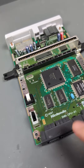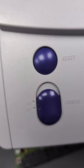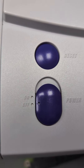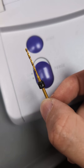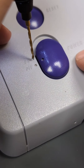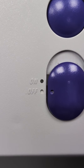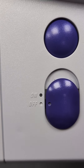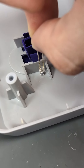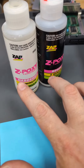Next up, for a power LED mod — on the original SNES it actually has a light, but you can see on the Junior there's no power light. What we'll do is put a power light where the on little dot is, just pilot hole that out, and then fill it with epoxy to give it a nice clear finish with an LED. We'll use a 1.4mm drill bit, which fits perfectly in the hole. That gives us a nice seamless hole to get the LED to shine through. We'll use a 3mm purple LED, and I'm going to epoxy the LED in using Z-Poxy — by far the best I've tried, because it sets rapid and hard.